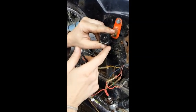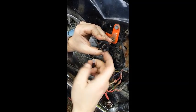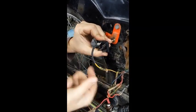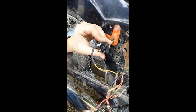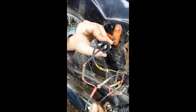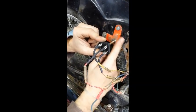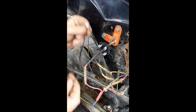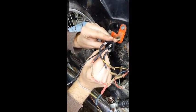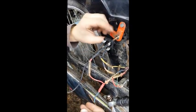So the way this works: if you have your spades, three of them will face horizontally and one vertically will be on the top right. Your yellow wire goes on the top left. Your red and white wire goes on the vertical spade. And your pink wire will go on the bottom right. Now the old rectifier grounded through the middle to the frame; this new one will ground on the left. So I've made a new black and white wire — it can be any color, just keep track. Honda's ground color is usually green, so if you can keep continuity with that it would be easier.